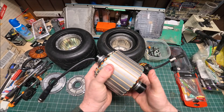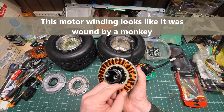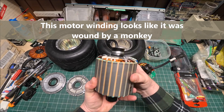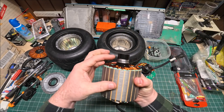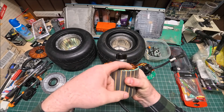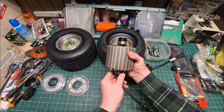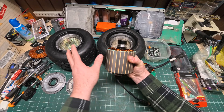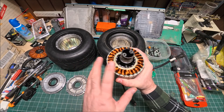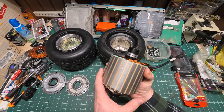On the other hand, the winding on the Super Flux — like I mentioned in the previous video — the quality is not good in my opinion. The wire alignment has big gaps between wires. This part is sticking out like 4mm compared to the other side. It probably is a prototype or pre-production version, because a few other guys who have motors from Fungineer say theirs look much much better inside — no nasty mess like that. I hope it's a prototype and I hope no one else receives one like I got.